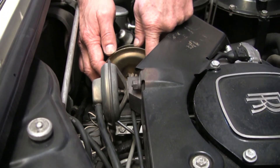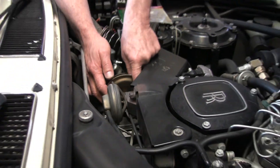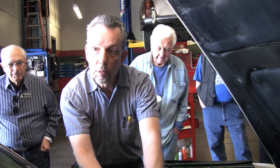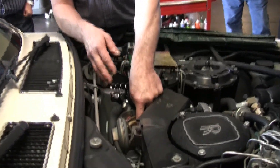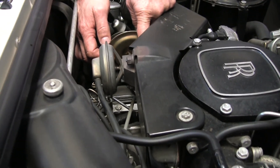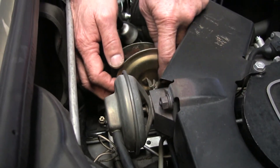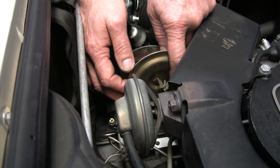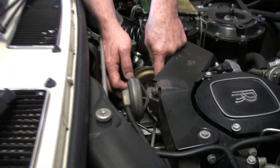...the parameters have to be right — the brakes can't be on. It runs through the brake light switch, and the speed has to be at a certain speed, over 40 normally. When you press that set button, engine vacuum pulls the throttle open. There's a small computer in the dash that adjusts the speed according to inputs from the transmission and what you set it at, so it modulates.